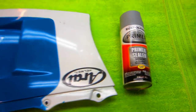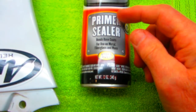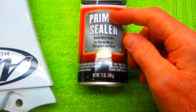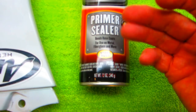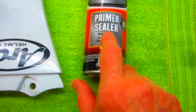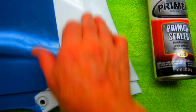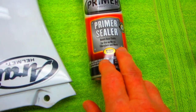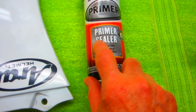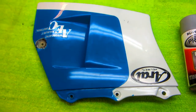I enjoy checking out new material. I've never used this primer sealer before - it's really important. When you have a sealer it's probably great for plastic, maybe good for metal, but it's almost a must when doing a piece of plastic. As you sand through in spots and do repairs, I want this to seal it up - otherwise you run the risk that the plastic will eventually melt.